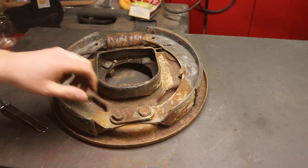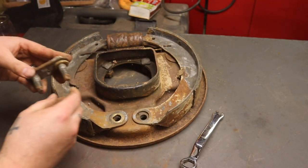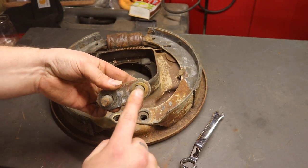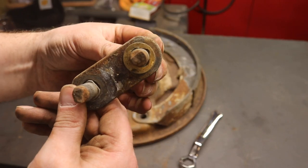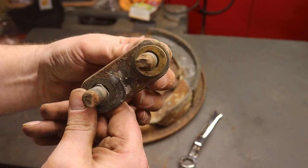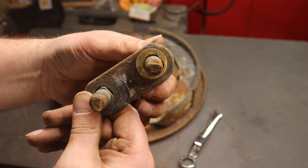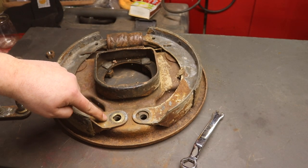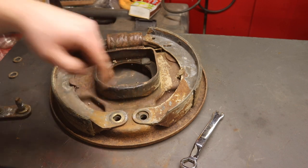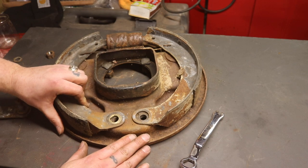Here's the inside and we're going to take these off. Now here's the view from the outside. We spin this adjuster and when we spin it, that brass lobe is bigger on one side, smaller on the other — so that's how we're adjusting the eccentric. That little brass lobe sits inside the brake shoe. This one's off so you can see what that one looks like; this one's on so you can see what that one looks like. So that pushes it either farther out or closer in depending on your adjustment.